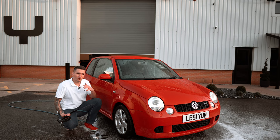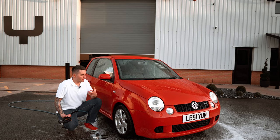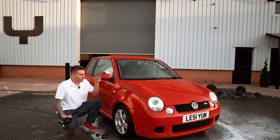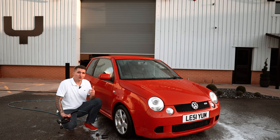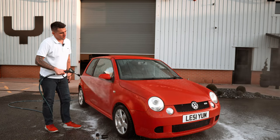You have to use a pressure washer for this. The pressure gets the film away. This is not designed to be used in a spray bottle with a typical garden hose application because you will not get the pressure and water flow needed to rinse away the protective film, and you will most likely end up with water spotting and a bad result.